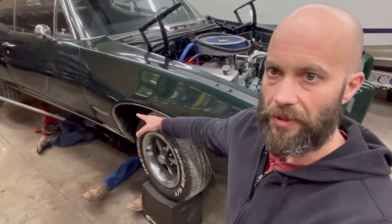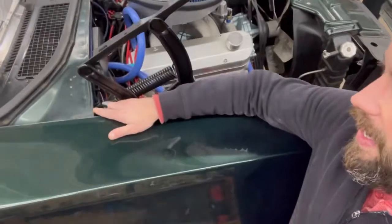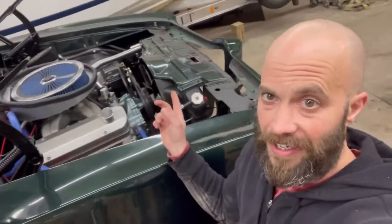As you can see here, the front end is not aligned, and also down here the door isn't aligned along with the fenders. When we put the hood back on this car prior to taking it in, we had new hood springs and a new hood latch - it actually wasn't latching correctly and was getting stuck no matter what position you'd put the latch at. So we knew something was wrong. On top of that, when we put the new hood on with the springs, it would sit level in the back but not in the front. Going through this, we noticed a lot of shims put in place on the body panel - don't mind that bone stock overhead cam six there, by the way.